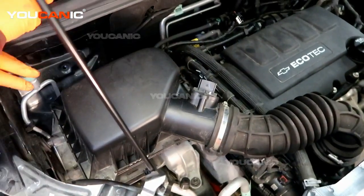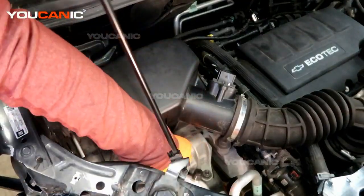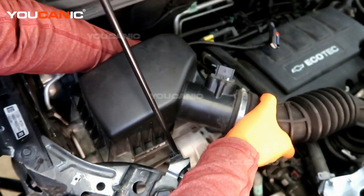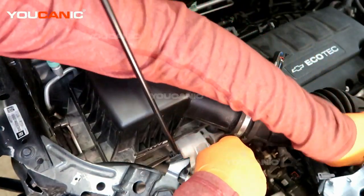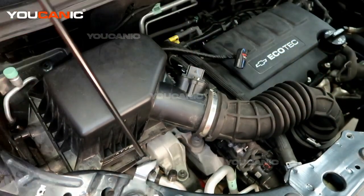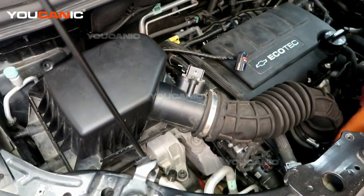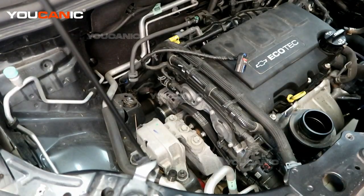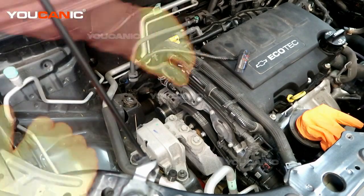The air box is essentially free — it also has a little down pipe here, which is broken or missing on this one, but it would mount up to the top here. We can just pull this up; it's held in by a grommet on the bottom and the top. We're going to undo this clamp with a seven millimeter to take off this whole thing and get it out of the way. We'll put a cover over the inlet pipe so nothing falls down in there.